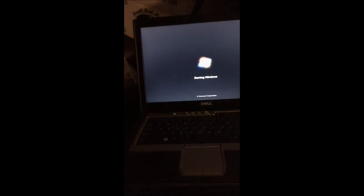I have Windows 7 on this computer. I like Windows 7. It's fairly simple. It actually clones over fairly easily. I think it clones over easier than Windows XP. I've cloned 7 over without having to reactivate. And so from here we go, whereas XP, sometimes you copy XP, then you've got to go online and reactivate, depending upon what kind of computer you're cloning over to.